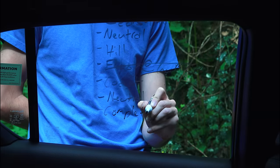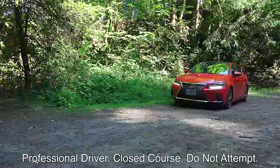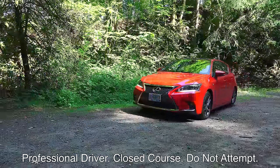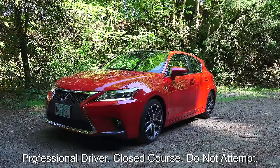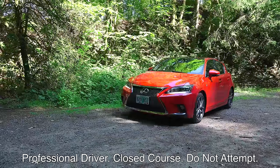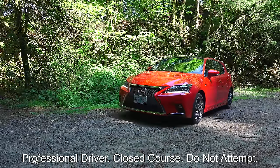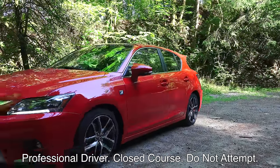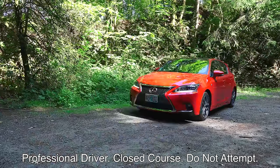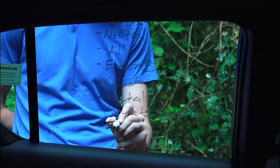Number 8: you should always come to a complete stop when you are changing directions. If you're putting it in reverse, don't do it while you're still creeping forward — let the car come to a complete stop and then change directions. This can damage transmission components. Just as I brought this up in the automatic transmission video, the same things apply to a CVT — come to a complete stop when changing directions.